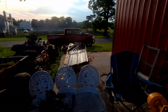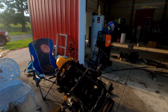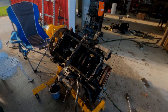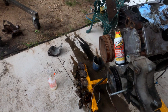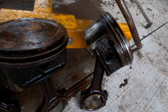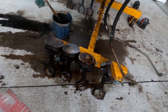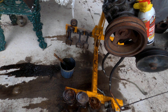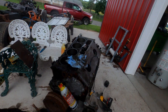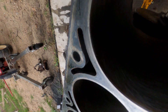Looks like old Virgil's going to get a fresh liter. I'll bring you guys back tomorrow - it's getting dark and I'm tired. So the pistons are out, and if you look close, the ring lands are just packed full of carbon and mud. I'm going to spray some degreaser on them, let it sit for a few minutes, and power wash them off. Let me see if I can get you down in there to see the bores.